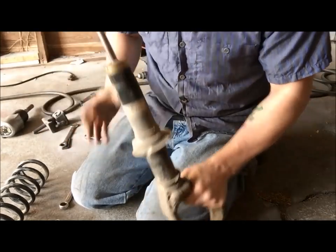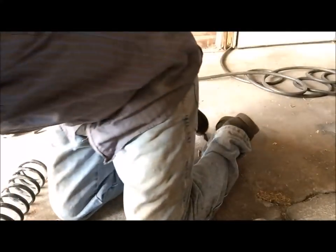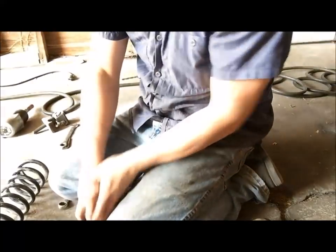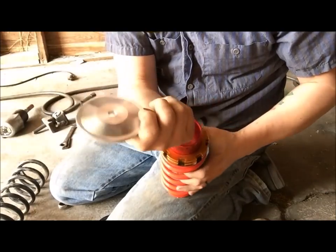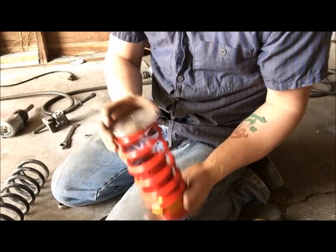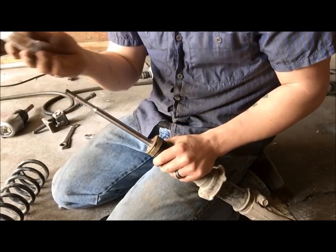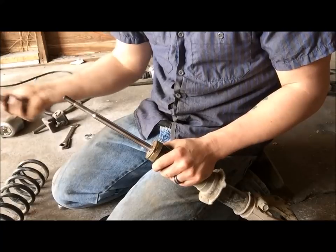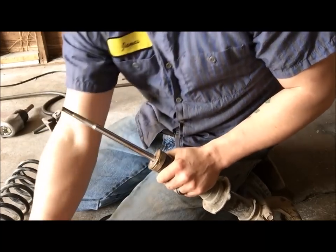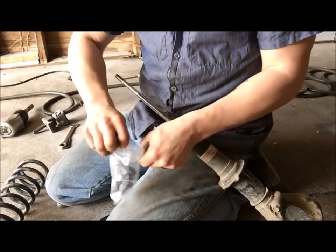You can see that. Anyways, I'm going to go ahead and get the O-rings on, and then we'll go down to putting the coilover on. Another thing is, I never see these metal top hats, actually this top part's going into the top hats, I never see people actually using them, so I'm going to try to find a way to use it this time, just because the holes are usually too small and people just say, oh, doesn't fit, and throw it off to the side. You can drill the hole out a little bit and then it should go right on perfectly fine. So we're going to go ahead and get these little rubbers on here and then go from there.